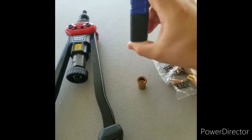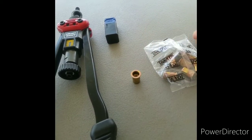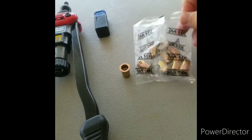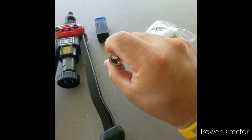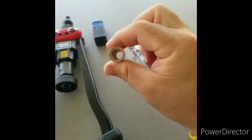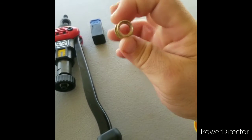The size I'll be using is an M10, which is equivalent to the 14mm bolt that goes in there. Now the threads are different, so I'm going to get a new bolt. It comes with a little pack like this, and there's your rivet nut tool. So you guys have got to drill out the hole to fit this in, and we should be good to go. I'm going to start doing that, and I'll show you guys.